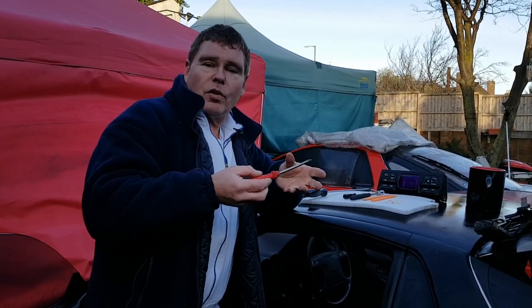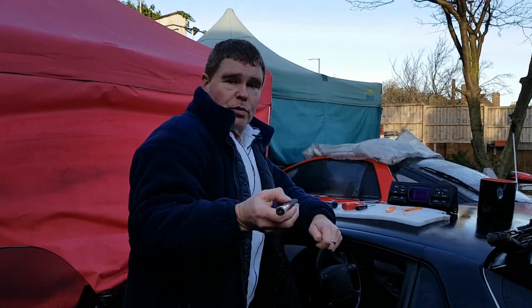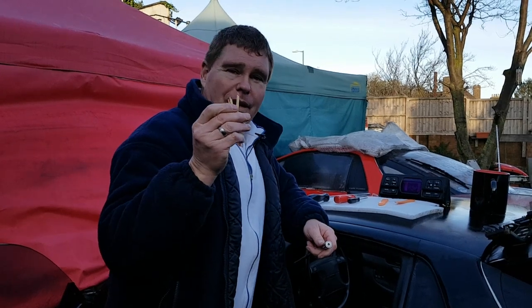The second thing is a shorter-bodied screwdriver with a Phillips tip - this is for those little tight spots where you can't get the long screwdriver in. The next one is a small flat-headed screwdriver; you're purely going to be using this to pry something out, so it doesn't have to be a screwdriver, it can be any strong-tipped metal blade that will allow you to pry something. Next is a couple of normal plastic trim tools, again to get out little plastic parts that you need to pry out. A small torch is also going to be useful as there are a few little dark spots in there.